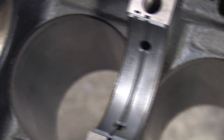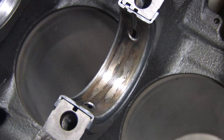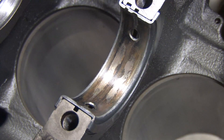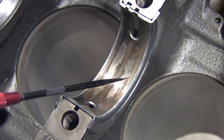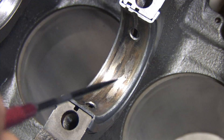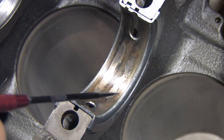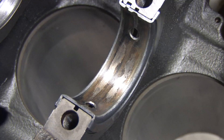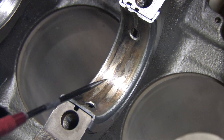Number 3 immediately shows light trenching and extreme particle wear. The brown area is ground up bronze shavings. This kind of wear comes from a dirty oil supply, and it makes sense because a lot of oil is delivered here. There are 4 oil holes on the center main, and oil grooves only across the parting lines of the thrust bearing. You can see the face is pretty badly beaten up — the wear is centralized on the saddles of the journal where those chunks exited the bearing surface.